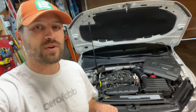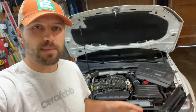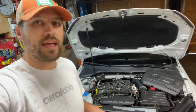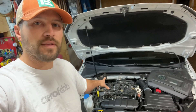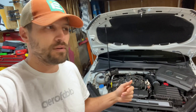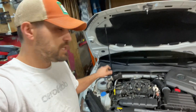In this video I'm going to be talking about my experience trying to mix fuels to get to E30, and later about the performance benefits. I did a video a while back comparing stock versus stage 1 on 91 octane, and now I'll look at what this stage one E30 tune does. It got better, and I think it's pretty close to traditional stage two power if you're going to go do a downpipe and tune. I don't have a front mount intercooler — it's all stock.